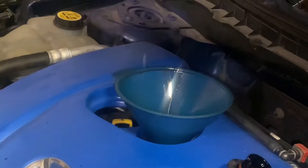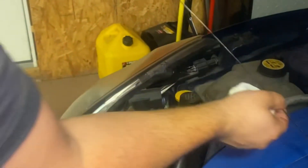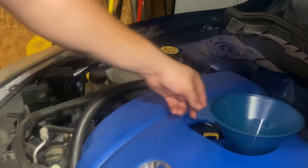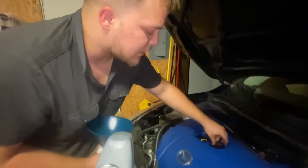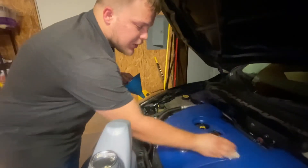While it's still there, check the dipstick again. As you can see it is enough oil. According to this it's right there, but just to make myself feel a little better I'm going to pour all of it in. Apparently this car now takes exactly five quarts — and as you can see, max level. Now all that's left to do is clean up after yourself, wash up, and you've successfully completed an oil change on the 2012 Mazda 3 Skyactiv.